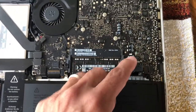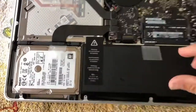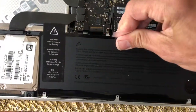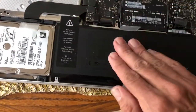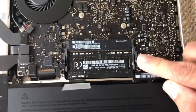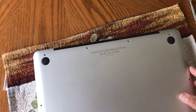What I would do is wait about a minute with the battery unplugged. If you want to replace the battery, once the two screws are taken off you just lift it from here and wiggle the battery out. I'm putting it back on since I'm using the same battery — it goes back on, I'll put the two screws back in, connect it again, and put the cover back on without screwing it down, then plug it into the charger to see if that makes a difference.